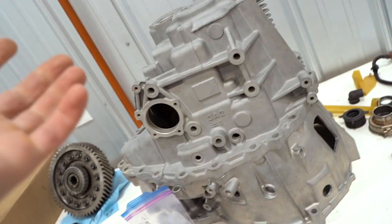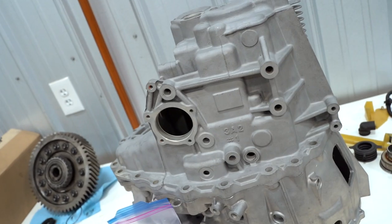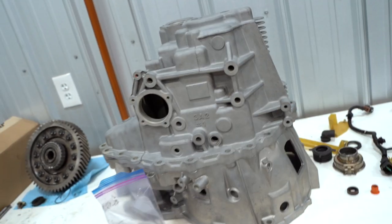All right, I'm checking over the application guide right now. Cerakote recommends to soak all the parts in acetone or degreaser for 30 minutes. Of course, we don't have a bin big enough to soak an entire transmission in. And not only that, that'd be like 10 grand in acetone. I just talked to Cerakote again, and they recommended to spray everything down with brake cleaner multiple times, wipe it off, spray it again, wipe it off until there's nothing left on the rag.